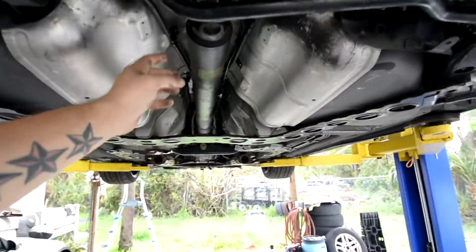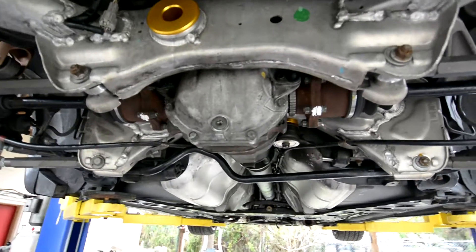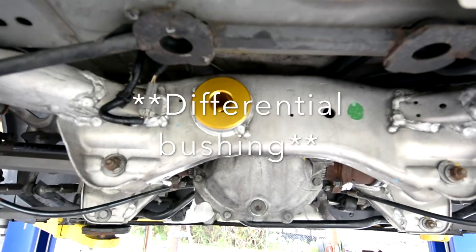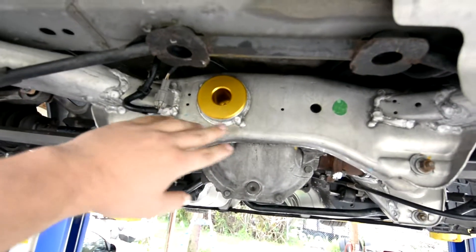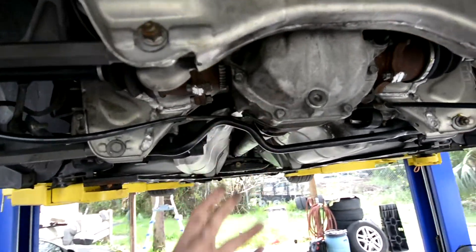I had to remove the exhaust, the drive shaft, the axles, and the differential to get the T-fitting up there. Since I already had the differential out, I decided to install my Parts by Max solid subframe bushings to eliminate wheel hop and all that aggressive lift you get with a lot of differential movement. All of that wasn't as bad as trimming down the center console for the hydraulic handbrake. It was all pretty self-explanatory. I could make a tutorial video but I was falling asleep editing it, and if I was falling asleep, you guys would too.